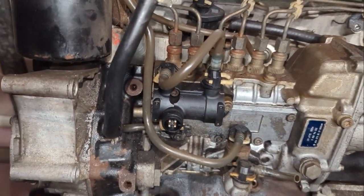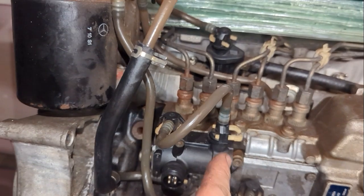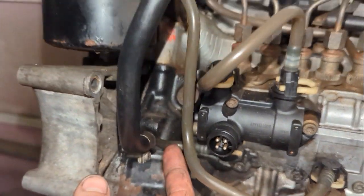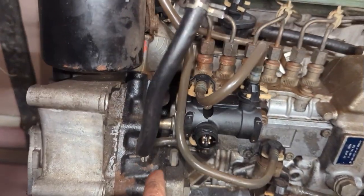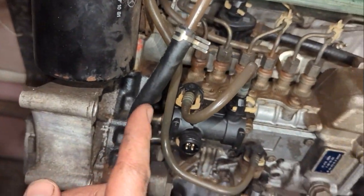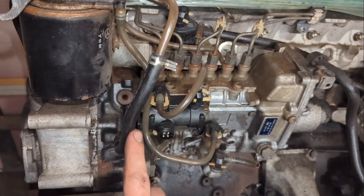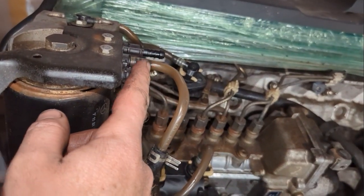So this is what I did. I used this hose which originally went from the pre-filter into here and just looped these two. Down here, the one on the bottom of your shutoff valve I left a piece of the plastic hose that was on there, and this is just the same hose that goes back to your tank. I just used what I had — looped the fuel filter out back onto here. The diameters are different: the one that comes from the tank to here is thicker than the return line.